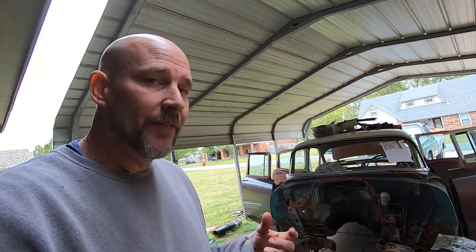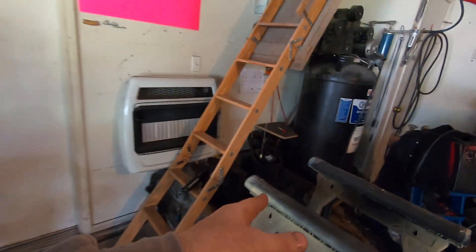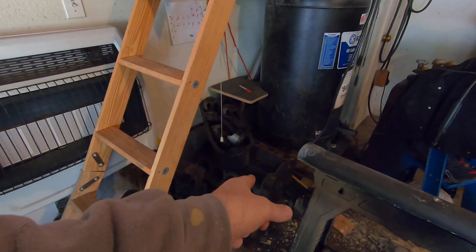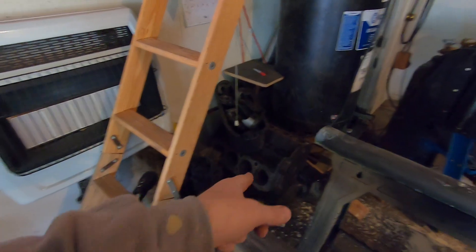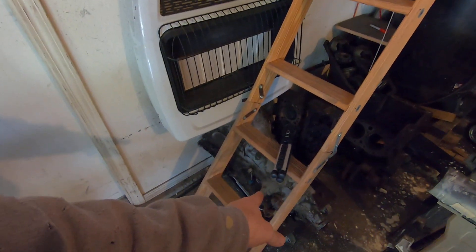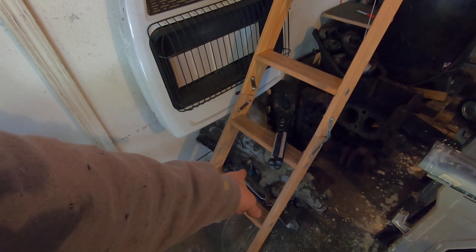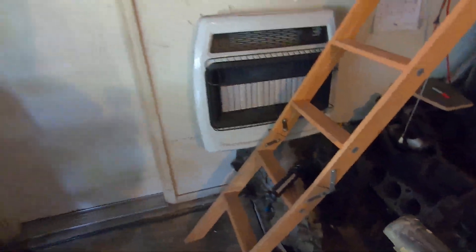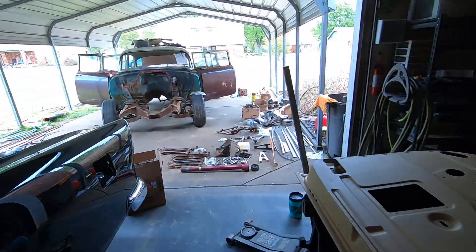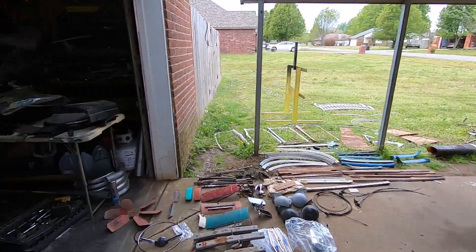The main plan — I was going to do some sheet metal work, but what I've decided to do is use an old worn-out stripped-apart 305 over here as a mock-up block. The transmission I'm actually going to use in the car is a TH350 short tail — it's actually a 350C, it has an electronic lock-up converter which you don't even have to hook up. I've run many of those through the years.